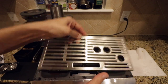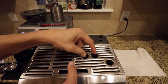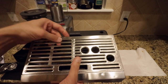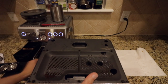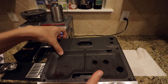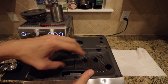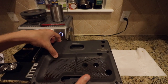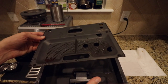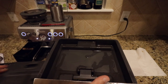It's a two-part system — you get your tray with the two holes for where the shot goes if your cup wasn't in place, and the steam wand hole. There's also a grinds separator that you'll need to rinse out pretty much every other time you pull espresso. Once you take this off, you come down to the actual reservoir where all the water is held.